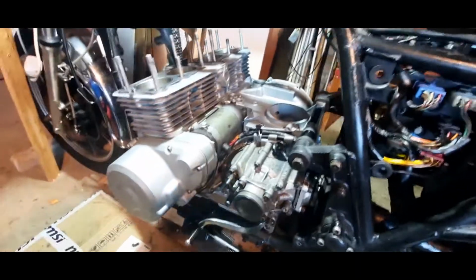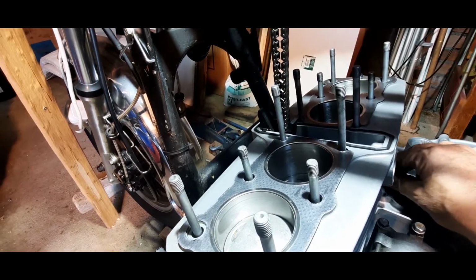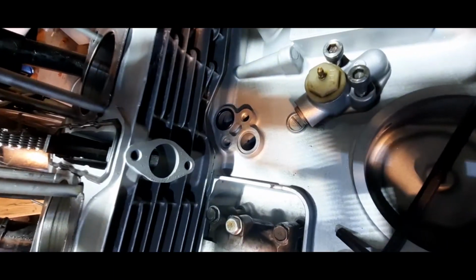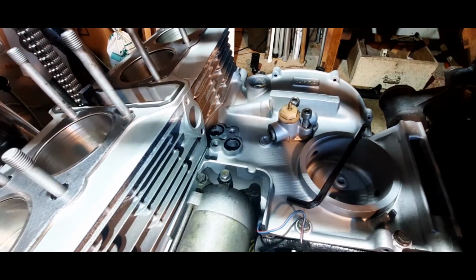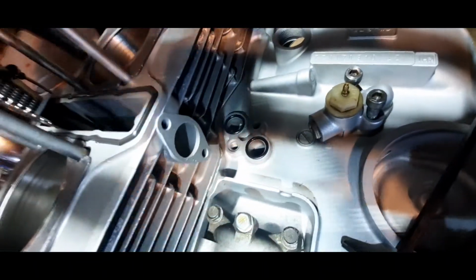Let's go over to the bike. Put that down there a second. Leave all those there. Put the O-rings on the oil switch. Just have a better light on the subject. There's one. Do you guys see that? And here is two. Now it might be an idea to use the ones which are quad O-rings. They've got four little flanges on them. But to be honest with you, as long as the O-ring is slightly proud of the surface, then I think we'll probably be okay.